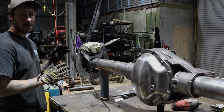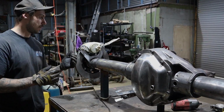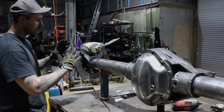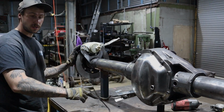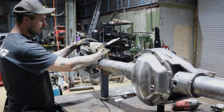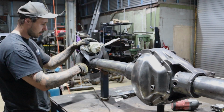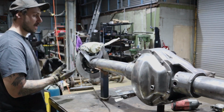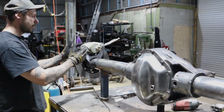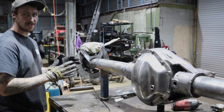We've got the tricky part now of actually assembling this brake caliper and trying to situate it where we want it on the diff. Now, the orientation or anything like that, we'll have to rotate it. Inclinometer off the diff will sit true 90 degrees perpendicular to the table, which I've already set up now. We'll chuck that on top of this bracket. We'll run that at 30 degrees, which is in reference to this being 90. Once this bracket is on here and rotated, we'll push the caliper side, which has the piston, as hard as we can to the disc brake, because when it actuates, we'll actually pull the other side as a slide and run across. So there's a couple of variables you've got to do.